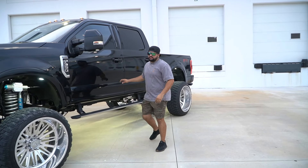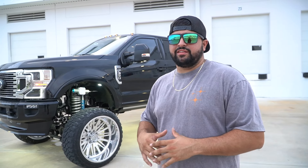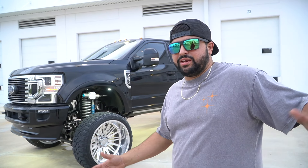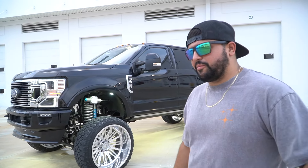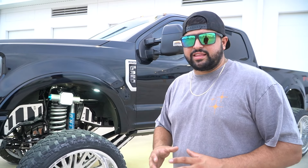We just finished up the full-duty build. You guys can see it's sitting at 9.5 inches. Remember this is a 4.5 to 10.5-inch adjustable kit. We got everything dialed in, got it aligned, and finished the last lingering parts. I absolutely love it — I think it's our hardest radius arm lift kit truck yet. We went ahead with that 7-inch spring and 2.5-inch level which gets us to that 9.5-inch height. We have a set of frame plates to dress up the chassis.